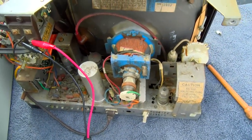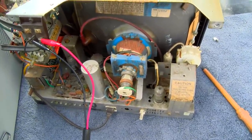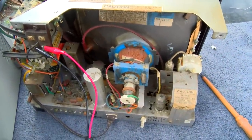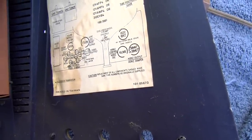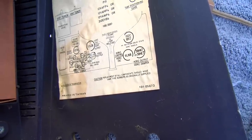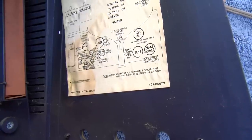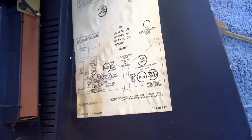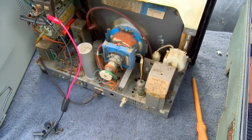These pop up quite often — they come in a bunch of different chassis variations, some different sizes, but they're pretty much all the same thing with different gimmicky cabinets. They show a 1X2 for the high voltage rectifier and it is not. Tubes are: 6LN8, 38HE7, 17JZ8, 12FX5 for the sound. They probably didn't want to go solid state with the sound because they wanted the delay — you wouldn't have wanted the sound to come on instantly and then the picture much later.